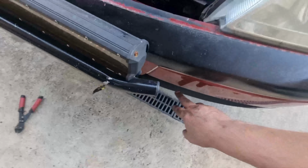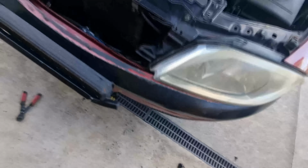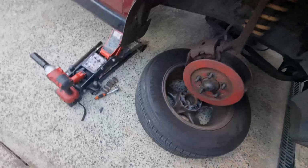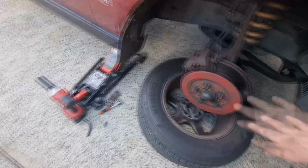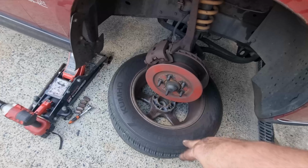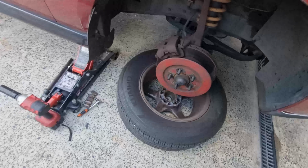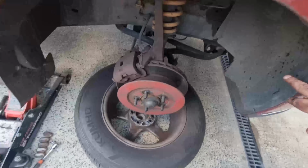Right, so I've got the beam light disconnected. I've got my foggies disconnected. They're all just plug connected. I don't have my stands with me, so as a safety precaution, I'm putting the wheels underneath there. Some people like to put them up there. I like to put them underneath here. I'd much rather save everything that's in there rather than the rims if it was to come down. So that should be fine though. Putting faith in a jack is not a good idea, but I'm not going under the car, I'm just next to the car.